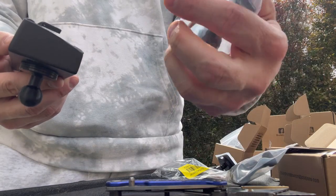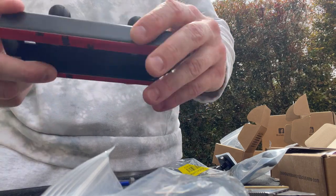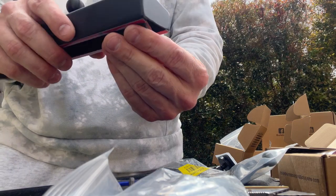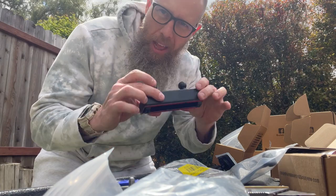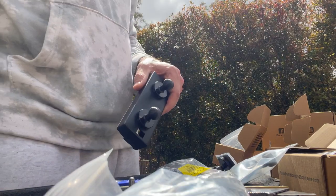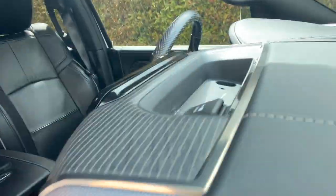It comes with install tools — probably even the right Torx bits you need, which is crazy. The mounting pieces are screwed in, and it also comes with a screwdriver. All we're going to do is mount this straight down — it goes in and there are holes all the way through to these tabs. These tabs are where we go back in with the standard Torx screws to pull it down. Then we can add the arms and magnetic mounts. Now in the Ram there's a slight angle to the mount — make sure the taller side is towards the windshield, because it's going to tilt and fill the little holes. The tabs go right where the T-screws went in before, and it levels everything off at the right angle. Perfect fit.